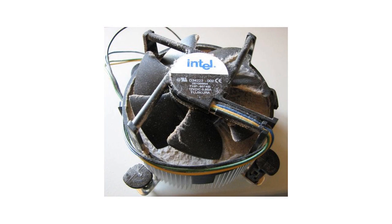There are a few things you need to watch out for. Obviously dust — if you're using the stock cooler, you're going to need to check for dust more often. Those things pick up a lot of dust, and especially if you're running your hardware so fast, you need to make sure it's all clean and working as well as it can. Also, if you're overclocking in winter, your room temperature could be considerably lower than in summer, so watch out for temperature changes.